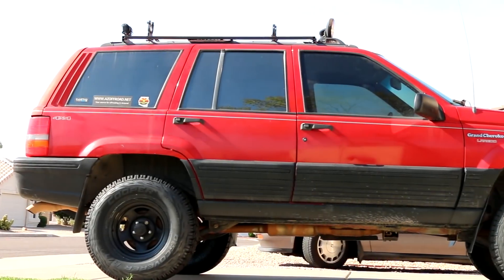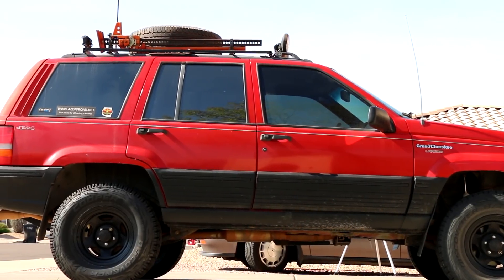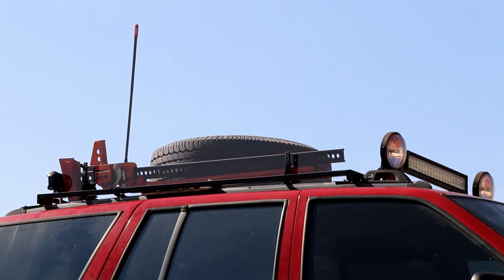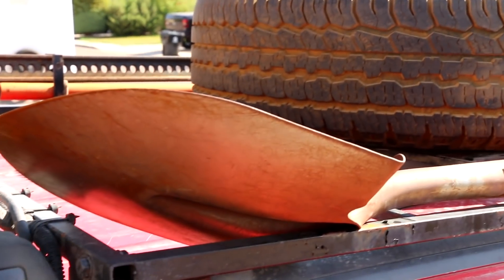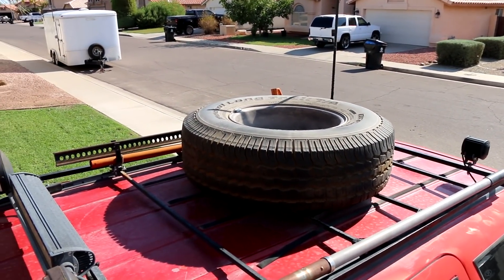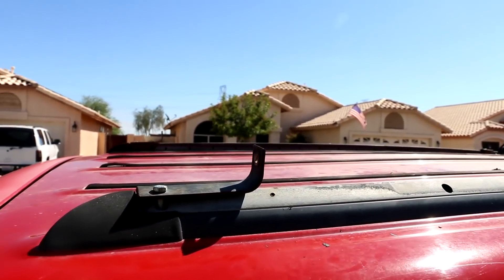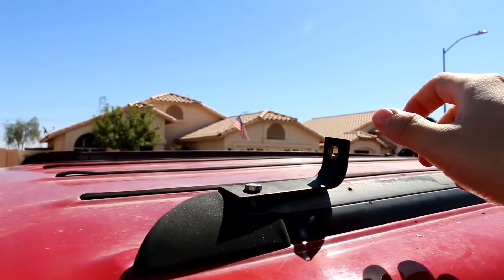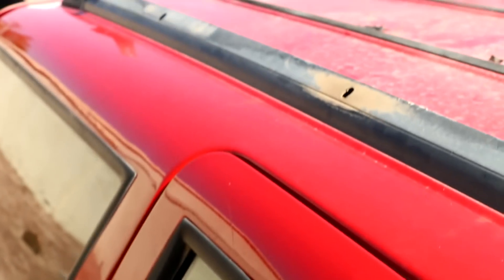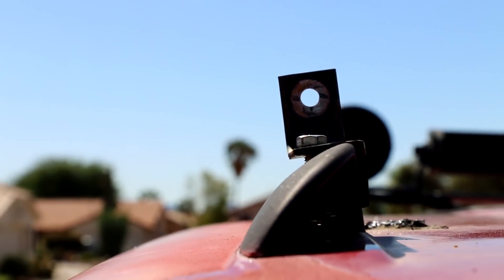For the last three years this has been the setup for our roof rack. Up until the last few months before we installed the new rear bumper, the rack also held a spare tire, high lift jack, CB antenna and lights. The rack was designed to be very low profile and light while giving us room to mount or temporarily store some small loads while out on trips. The rack was built using square tubing around the perimeter, with slightly thinner square tubing making up the inside supports, and a variety of miscellaneous metal pieces for the accessory mounts. The rack was mounted to the Jeep using custom made metal brackets that bolted to the roof rack on all four corners and then attached down through the roof using the existing holes for the roof rails.